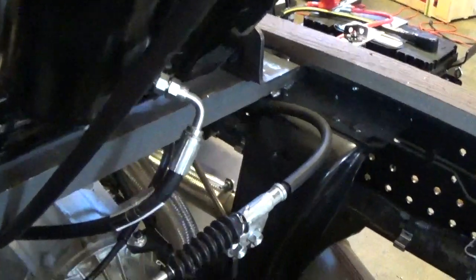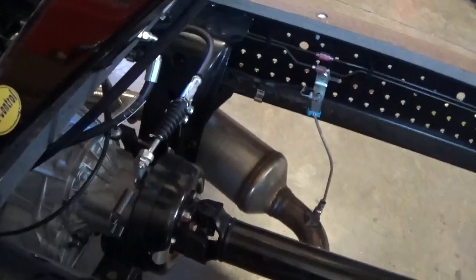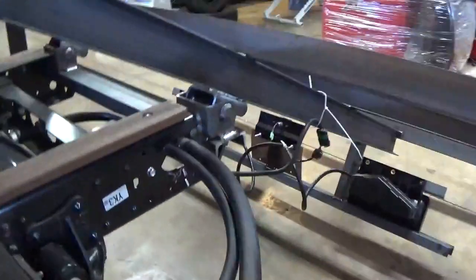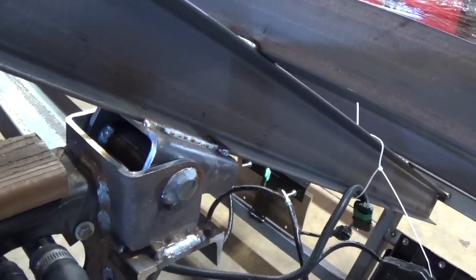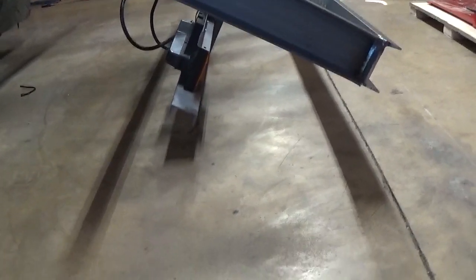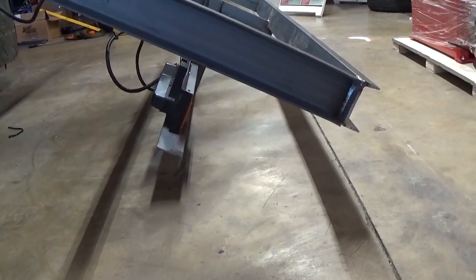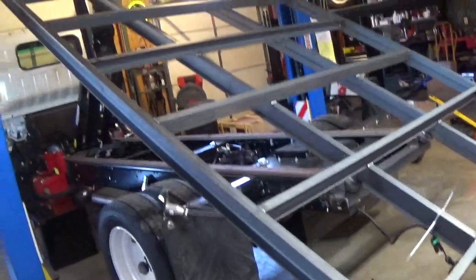We need to wire-tie the hydraulic lines back and make sure they stay out of the way. If we'd bought the smaller unit it would have tucked right in without coming up quite so far, but we want to make sure we have the biggest support we can get. Here is the hinge mechanism on the back — we weld it to the frame of the truck and to the main rail on the flatbed dump bed. I'm about a foot off the ground back here, and the rear bumper and tail lights are about three to four inches off the ground, giving enough clearance for low driveways.